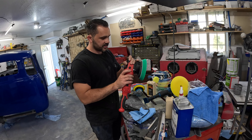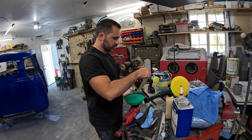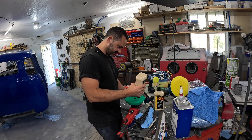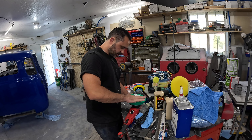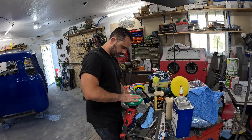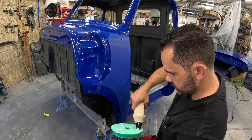You want to lay it really flat against it and hold it like that. I'm going to start low and then go up. You have to prime your pad — I'm going to use the ultra cut compound, the highest just to get the cuts out, and just rub it into the pad. Again I don't really know what I'm doing, I'm just trying here. Some people put compound on a panel and start it up just so it gets into the pad. I'm just going to kind of lather it into the pad and put a couple drops, just spread it and go low setting first.